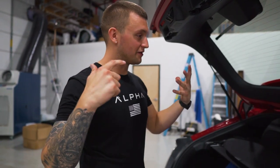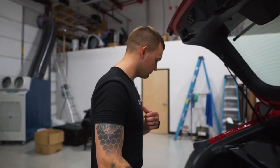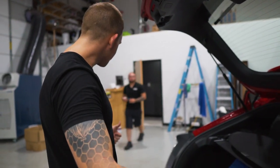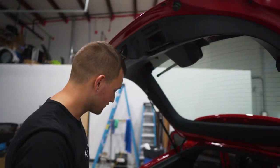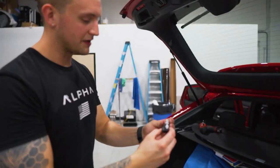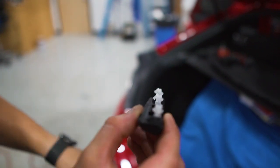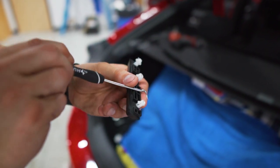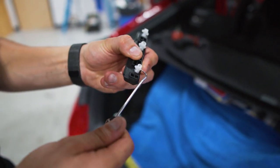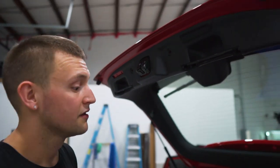I just turned on the AC because I was sweating and getting aggravated taking these rubber pieces off — this is going to be the hardest part. I've got a lav mic on now so we're good to go. So I took the one rubber piece off. Let me explain how it comes off: it has these rear clips you'll probably never see again, and it has little prongs on the side. What I do is use the gasket stick and take the hook tool, pushing these clips in one at a time. When you push the sides in, it releases — you've got to work your way across.